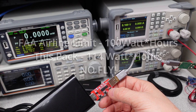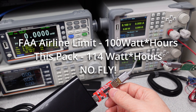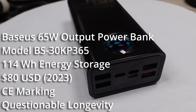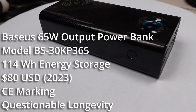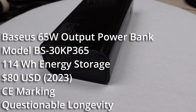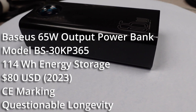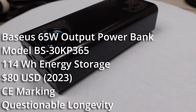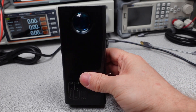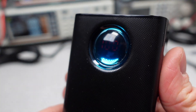The visual display is pretty bad. One question power banks always have is about travel on a plane — this adapter is over 100 watt hours, so it cannot travel on a plane. Don't confuse watts for watt hours. One thing I didn't see on this power bank is a US or Canada safety listing — this is a new category, so you will start to see this on power banks. This one doesn't have that specific mark, but it does have the CE mark. After all that, I leave the decision up to you as to whether or not you want this one. It is a couple years old in terms of design and has questionable Amazon review stats — mostly DOA issues and very quick failures. For me, this adapter will most likely spend a lot of time around 5 to 10 watts powering more basic USB-A devices. I've had it for six months now and it holds its charge fine, but maybe I got lucky.